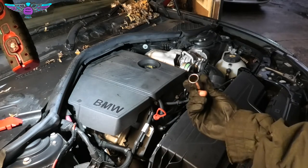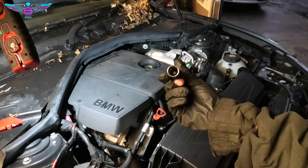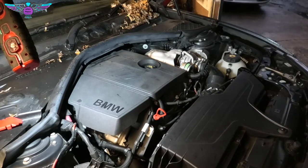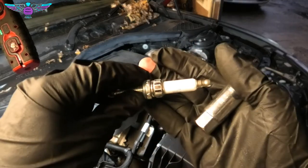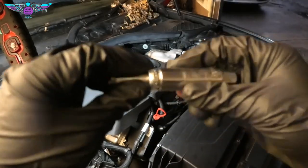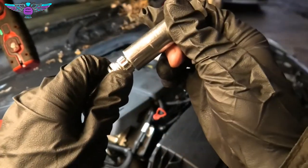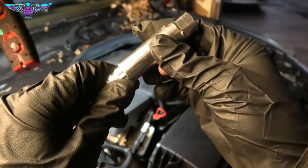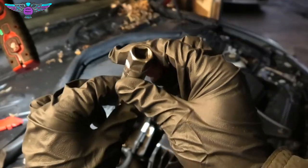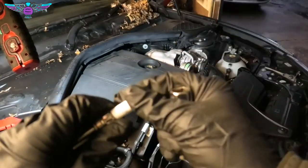We're also going to need these two tools. This is a 14 millimeter especially for spark plugs. These particular plugs are slightly different — they have this type of head here and haven't got the hex, so the tool needs to fit in like so. It's quite a skinny tool. There is also a rubber inside that holds the plug so you can get it out. I usually apply a little bit of WD-40 on this rubber when fitting it back.